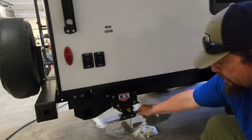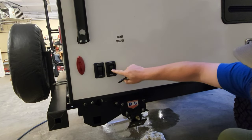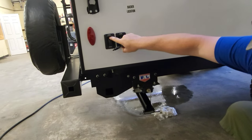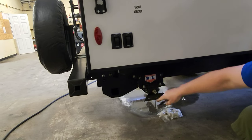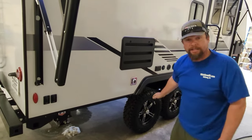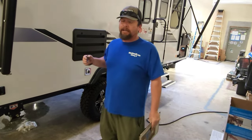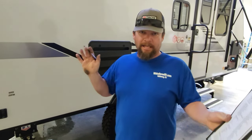On this next side — the stabilizer jack again. Remember the nut on there; you can manually operate it, but this is actually an automatic system. You have two levers here — one for each side — so you can extend them. These are just for stabilizing. Whenever you get yourself nice and level — whether with the tongue jack or blocks under your tires for left-to-right leveling — put the stabilizers down. On a 21-foot trailer without stabilizers, a couple of people walking around will have this thing rocking like a boat.